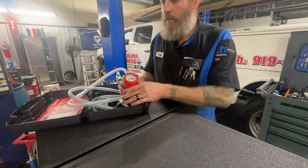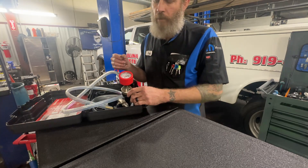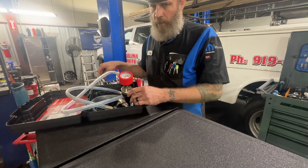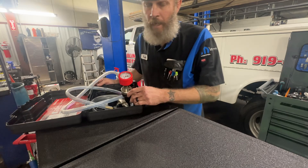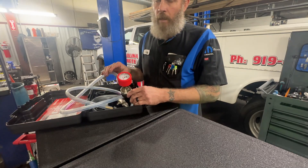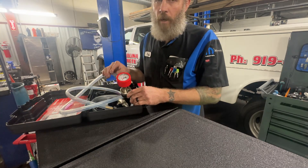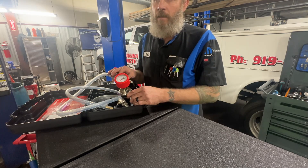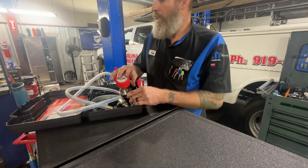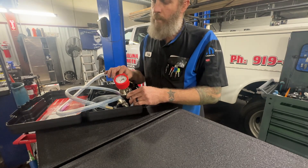This is an awesome tool. It allows you to put the whole coolant system under vacuum, collapse all the radiator hoses, then put the hose inside a coolant receptacle and suck the coolant into the system — instead of sitting there for an hour waiting for the coolant system to burp. A coolant flush is billed as one labor hour, and this tool lets me do it in about five minutes. So if you do a lot of thermostats, coolant flushes, or water pumps, this thing is a lifesaver.